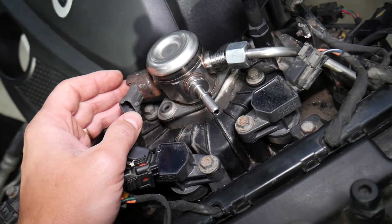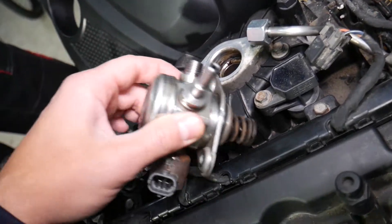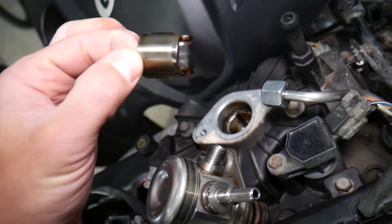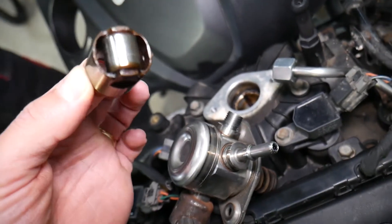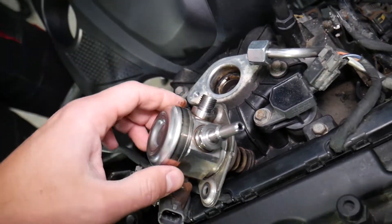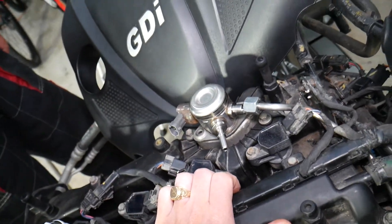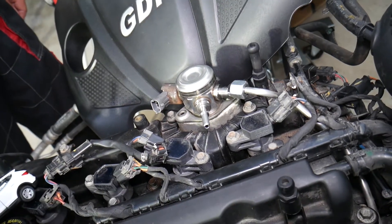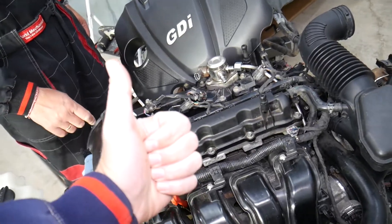If that doesn't fix the problem, it's very likely you have a bad sensor, and in most cases you'll need to replace the whole fuel pump assembly. If you do replace the high pressure fuel pump, never forget to also replace the tappet — on high-mileage engines, if those fail, they can destroy your engine, and they're not very expensive. We'll put the link in the description below. We also have a dedicated video on the channel showing how to remove and replace the pump. Hopefully this video is helpful — thank you for watching!